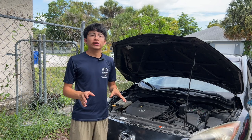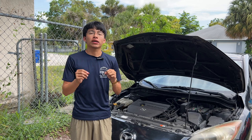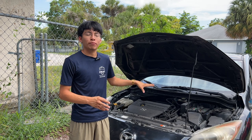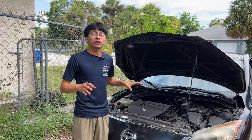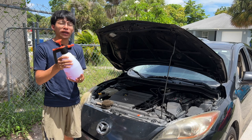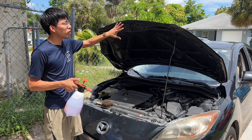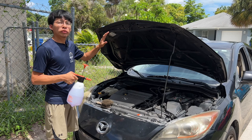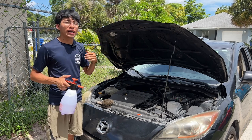Now that we're done blowing or vacuuming any loose dirt or debris, we're going to get to the actual cleaning. But quickly — you always want to set expectations with your customers: do they want a showroom shine result, or do they just want to improve the current condition and make it look a lot better? In this video we are just trying to clean and improve the look of this engine bay. For our second step, we're going to apply our degreaser — Super Clean diluted four to one — starting from the top to the bottom. I'll work on the hood first, spraying it on and working in sections, though you can always choose to work on it all at once.